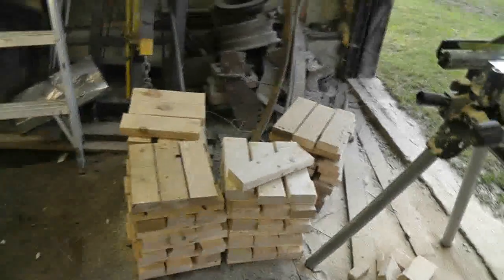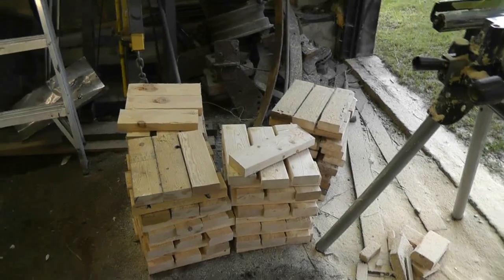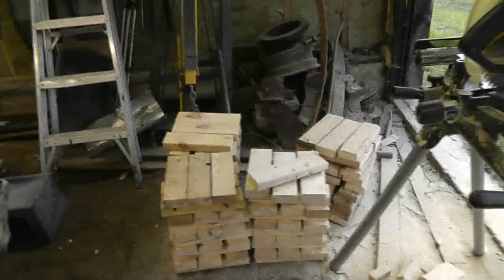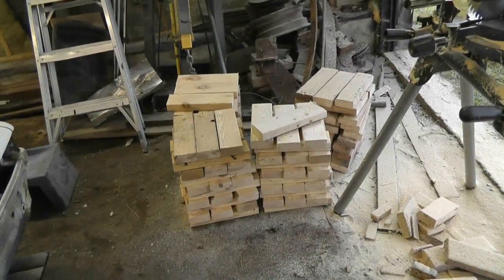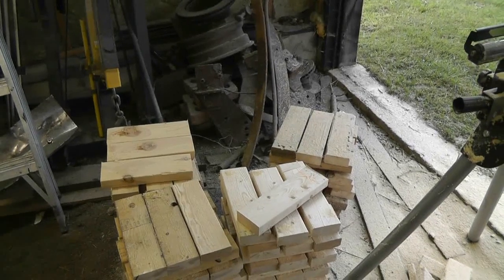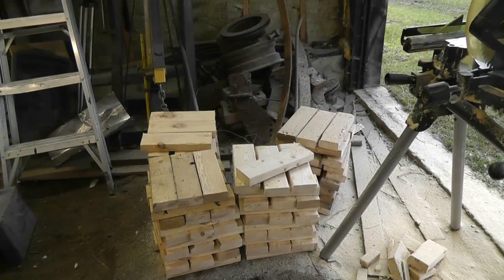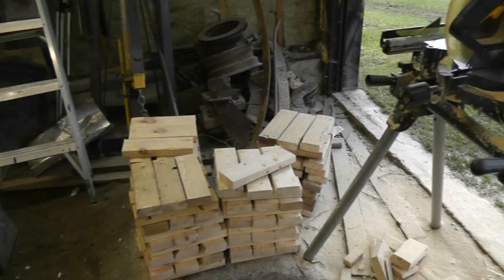I think that's a good safe way to go. These ones are all set up - I haven't obviously nailed them together yet, but I've got them set up such that they'll be about 15 inches high, exactly 15 inches high. Which is not quite high enough to pull the engine out the back - I'm going to be a couple of inches short. So what I'll probably do is cut a couple of 2x10s as sacrificial pieces to rest under the pinch welds on the edges of the body, and those will be what I use to space it up some. But I'll have to see how much I need to lift it.